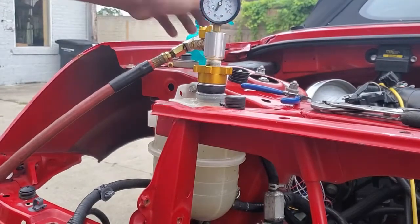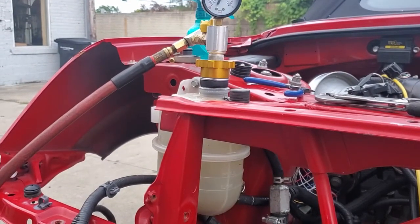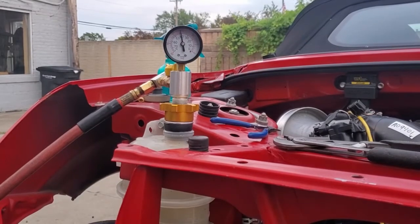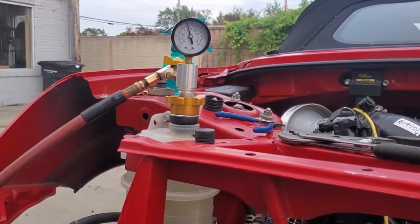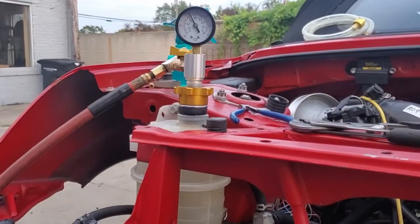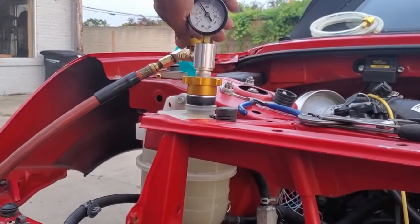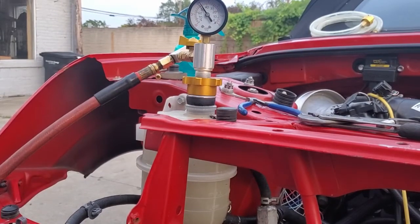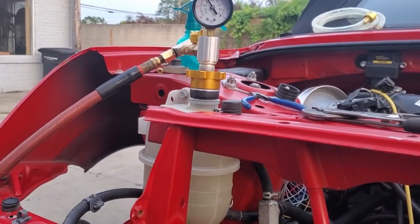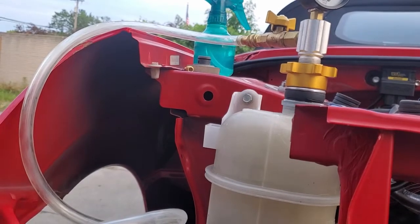The first time I did this I noticed a few spots with a leak. The first was the pressure release hole on the side of the reservoir, which is needed so that your coolant system doesn't just explode — I temporarily plugged this so I could pull the vacuum. I still had another leak after that, so I plugged the Venturi from one end and let the air hose compress the coolant system with just a few psi. Then I used soapy water to see where the leaking bubbles formed, and sure enough they formed right on the connection inside the reservoir. This knob expands the rubber to seal the hole and needs extra force to fit into the threads. After that I was able to pull a vacuum up to 21 inches with about 5 recharges, but wasn't able to pull more even at over 100 psi.